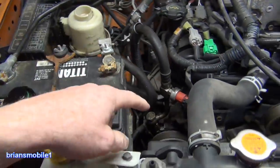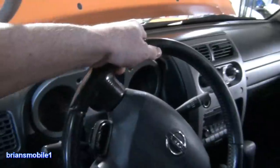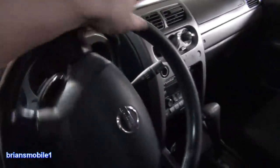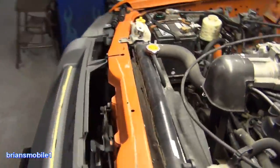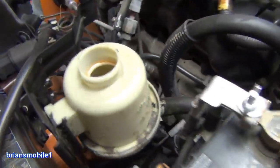In this particular case, we have a bright orange Xterra — and I love it. When you go to drive it, you pull out of a parking lot and there's just no power steering; it's really hard and you have to fight it. Then when the RPMs increase, the flow gets better and it turns easily. It's not howling though, which is kind of weird. We have a pump that's leaking and probably has some damage, so we're going to replace the pump and take care of the leak and damage in one fell swoop.